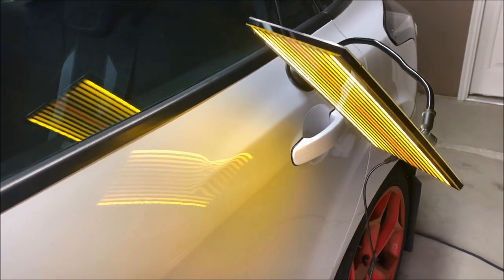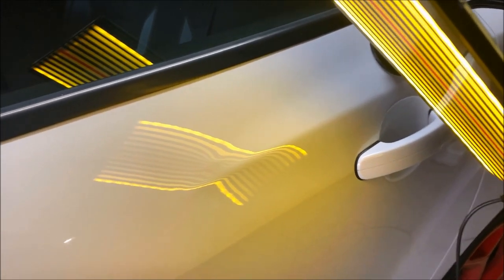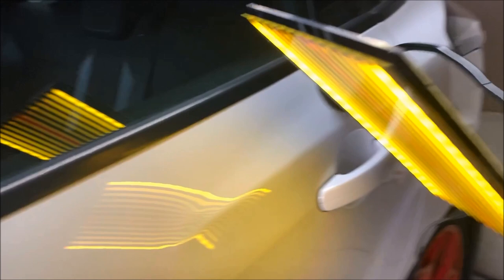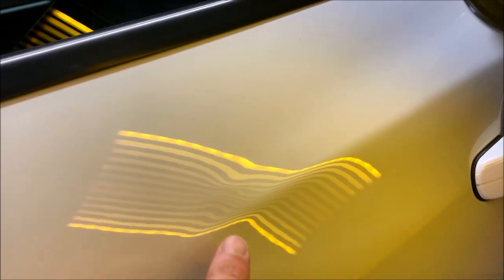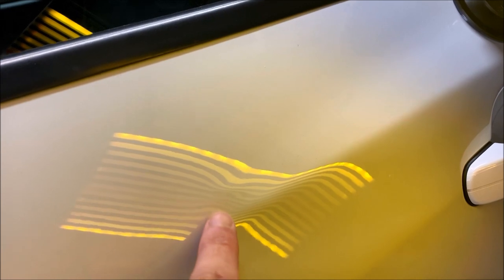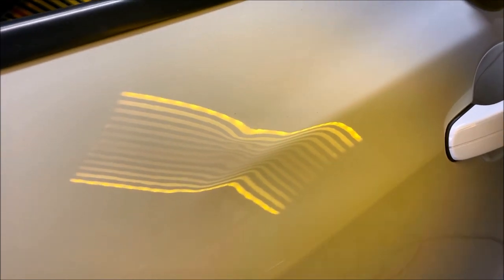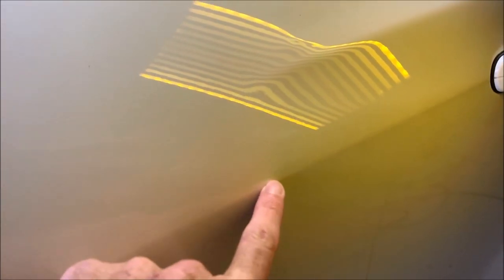This is how I have it set up. From my understanding, the light needs to reflect on the dent in the direction that the dent is going. Since this top dent was angled out this way, I've got it curved. You can see where it folds in and where it fish-eyes — that's a low point. Where the black lines are going in, that's a high point. So I'm going to use the knockdown tool to hit those edges around it, then use the dent puller to pull the center out, and do the same for the bottom dent.